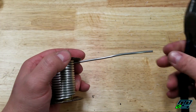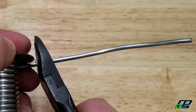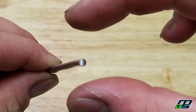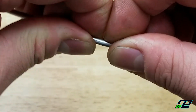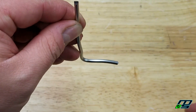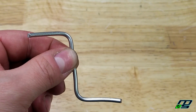I already have my section cut right here — figured I'd cut one for you guys just to show you exactly how it's done. We're going to make a section about four inches long. Before I cut this, I want to point out — when it's cut, it kind of leaves a point there. You want to cut both sides with a vertical cut, keep them both the same. You want to squish down on the cut perpendicular — I think you get a more accurate reading that way. So take about half the length of your cylinder and make a bend — that'll measure one side. You can see that line is vertical, making it easy to fit right into your spark plug hole. Then I like to take the other side and bend it like a Z so that you can use this thing twice.